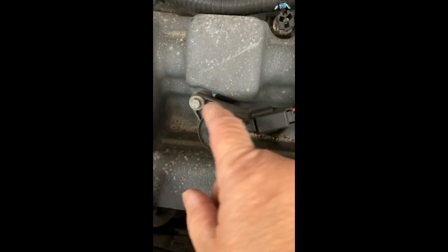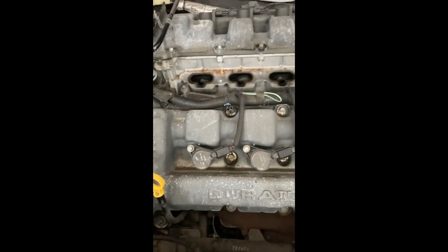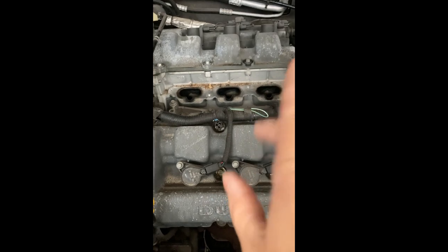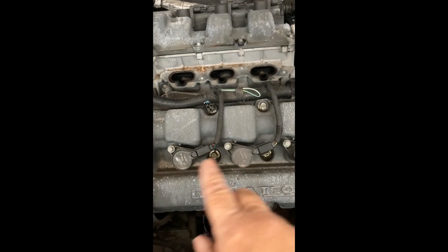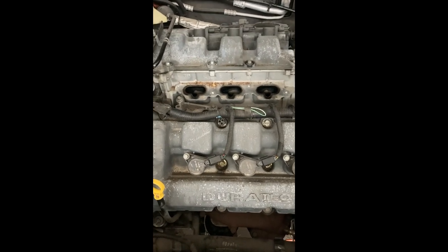Vacuum in here also. Before taking out the spark plugs, go ahead and vacuum inside the holes so that way it won't get clogged up. I'm going to start on the back because if I get tired, I could get those done first and then come back another time to do these because they're in the front. So I'll get started.